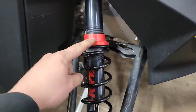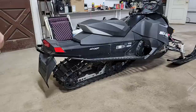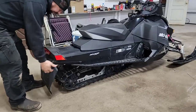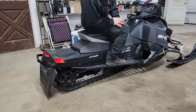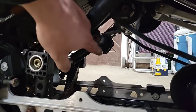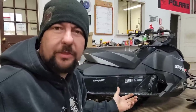Even just pulling it in off that trailer, this thing — you don't even have to put any force on it, she's dropping right to the ground. And if I sit on it, that snow flap is touching the ground. That's way too low. Looking down in here on the skid, you've got your springs on top of these adjusters and they are set on the lowest one. We can crank the tension up on these springs and see how that works out. The suspension on this thing is set just like Grandpa without his Viagra — pretty soft.